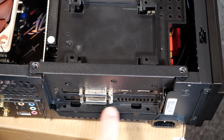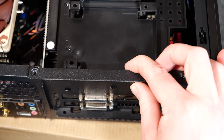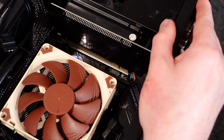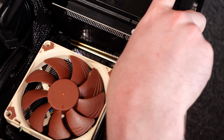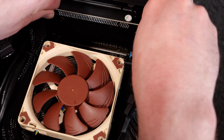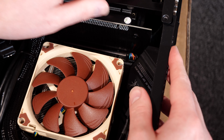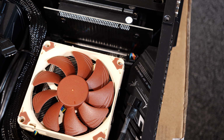So there's two notches, one right here and here. You wanna try to line up the card right there, just like that. On this side, you want to line up the slot with the slot. And it's probably best, just like when you took it out, to grab both sides with your fingers and just push down all the way. You should hear it click in, just like installing a normal graphics card. So now our card's in there, it's got power. Now we just put the screws on.